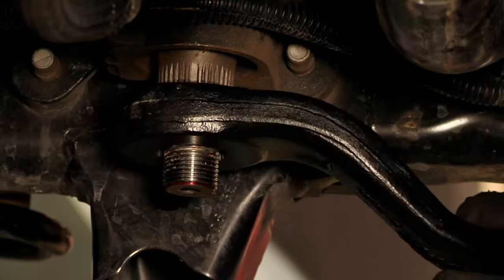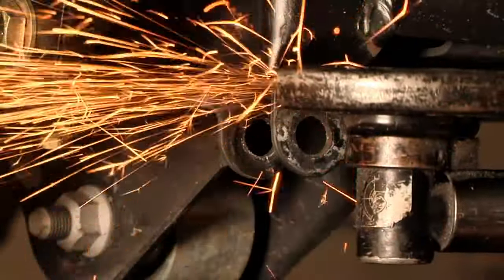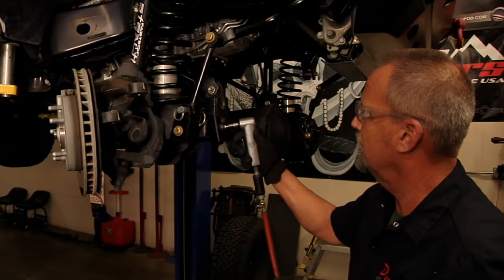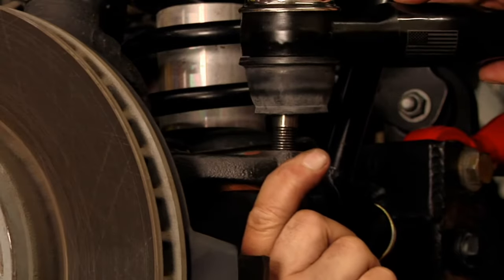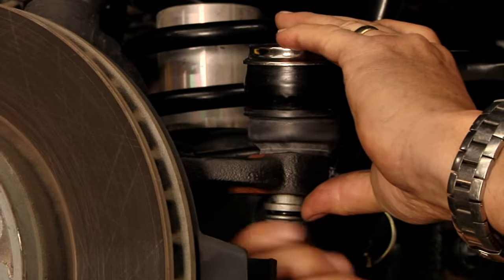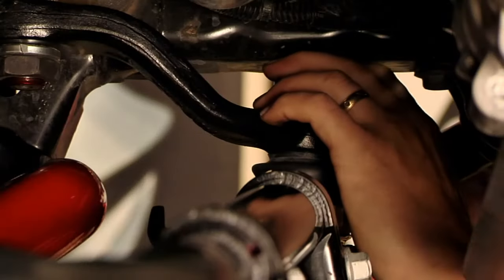While the drop pitman arm works great with the current configuration, we needed to replace it with a factory pitman arm for our new high steer system. The factory stabilizer mounts were removed because the Yeti system utilizes a high mount to protect the stabilizer from damage. Next, we installed the massive Yeti track bar. Be sure to tighten the Yeti components to the values provided on the torque spec card from Steersmarts.